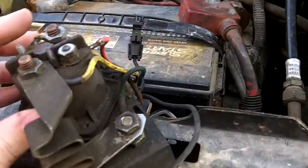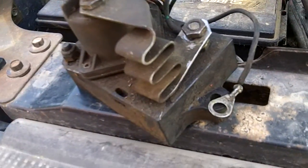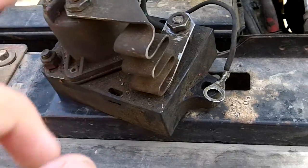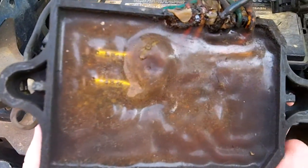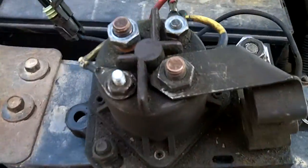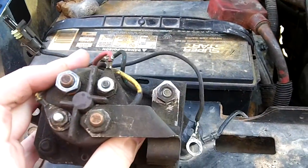So the way this works is you have this metal strip, and when you turn the key on, the power goes through all of this, and it gets hot because there's lots of amps going through it, and the hotter it gets, the resistance increases. And according to that, the solid state transistors and things in the bottom control how to cycle and when to turn on and off the glow plugs. This is all solid state. There's no ECU for this or anything. The glow plug is all controlled in this.